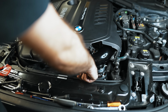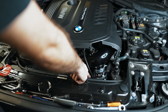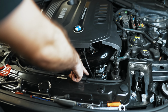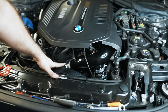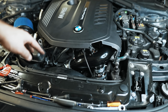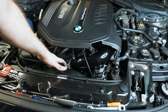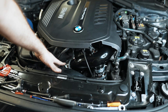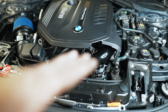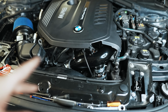I had to cut this line a little short to have a natural bend. It may be better to use the other side in terms of where you put this vacuum line because there's a little bit more room there versus over here. But still, I got my clearance from the ratchet route, so we're okay. And it's not the prettiest to put the clamps in this orientation facing up like that, but it's going to be good if you ever have an issue where it pops off while you're driving or something along those lines, if you're pushing the car. It's nice to have them oriented up so you can deal with it quickly on the road. It's a bit of a cosmetic upgrade being gloss black, but nothing crazy. It still kind of blends in.